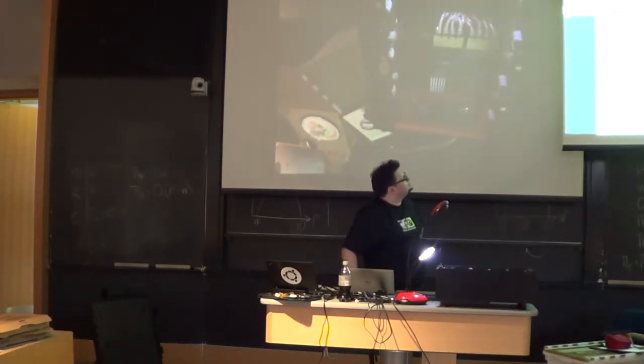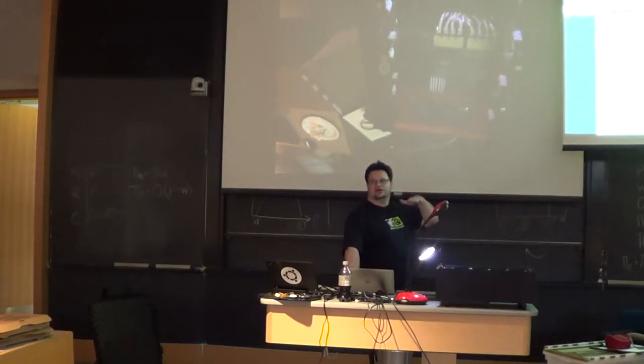So there are 10 nodes. There is a single power supply. The LEDs are already explained. Funny that the weight is in there, but yes, it's heavy. So it's an i5 with 16 gigs, and each one has 120 gigs as an SSD drive on board. If you know how the NUCs work, they have a space for an SSD card. GPU on board, obviously they have gigabit. 4 of them have those additional drives that I was pointing to.